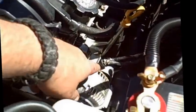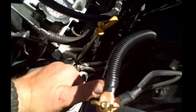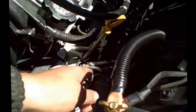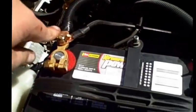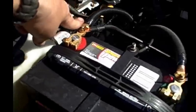You also have some ground wires up in there that hook up to your diagnostics. Another option that people do, and I might think about this if I have bad charging issues with my battery, is I use the old harness and the old connection. But the wire goes all the way across there to the box, and then it goes all the way back over here. So if I'm having a hard time charging, I'm just going to do a direct link with a fuse, 120 amp, whatever, 160, between my alternator directly to my battery. Make sure you fuse it. Everything gets fused up. You don't want to have any fires. That would ruin your day.